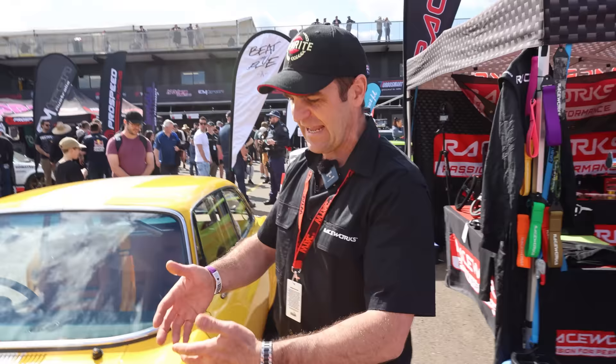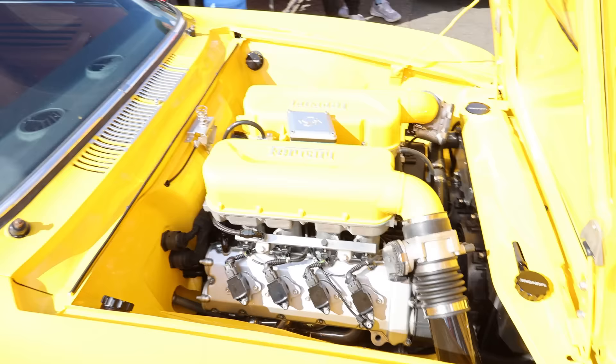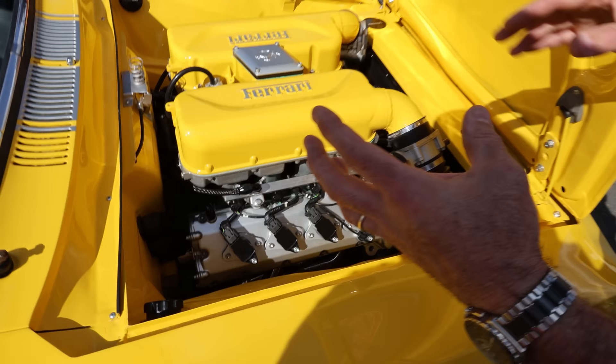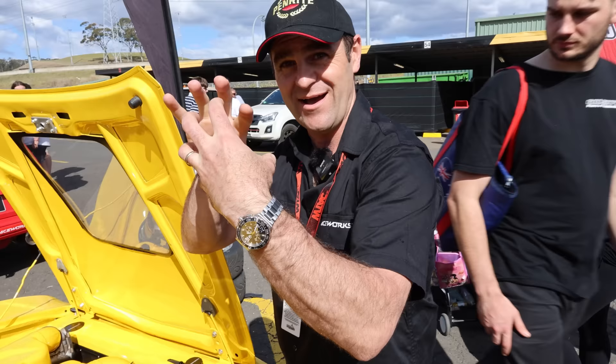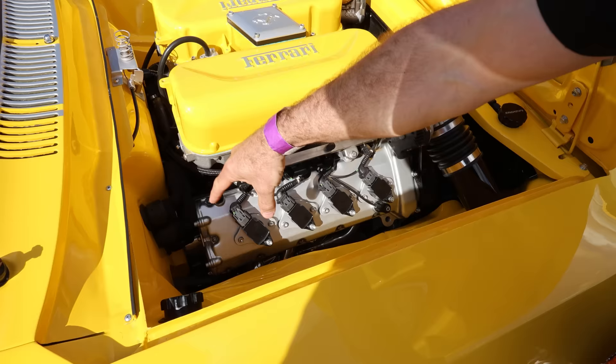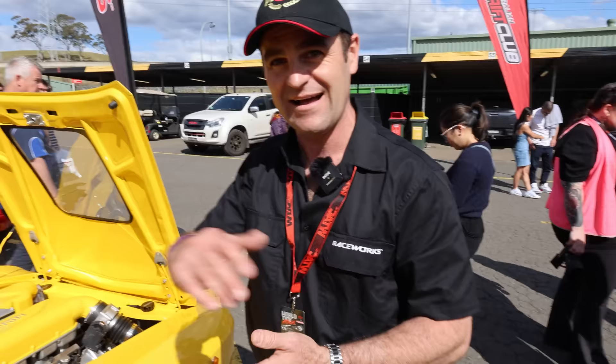Most of it is pretty straightforward - it's eight coil packs, eight injectors, twin throttle bodies, still the original throttle bodies, and the fitment is really good with about 10 mil clearance everywhere. One of the hard things is that it's a factory dry sump engine and the dry sump tank sits on top of the gearbox in the Ferrari, travelling internally through the gearbox through an O-ring on the bell housing. So I had to build a custom 50 mil adapter plate and a custom oil tank that fits behind the guards.